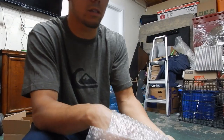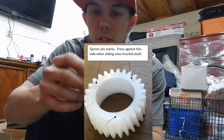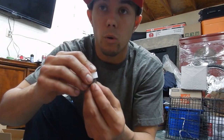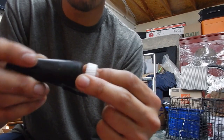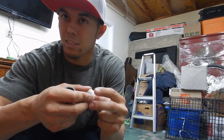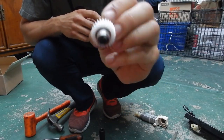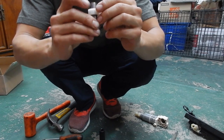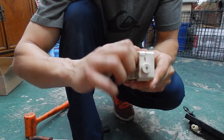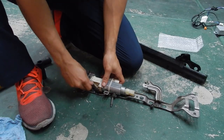Link in the description for where to get these gears. The new gear has three little divots on one side and nothing on the other - use the divot side toward the knurls, with the opposite side's inner lip matching the inside lip of the housing. If it's any wider in diameter it will push against the worm gear and chip the plastic. Press the new one onto the knurls and ensure there's no play, then line it up and put the bolts back through.